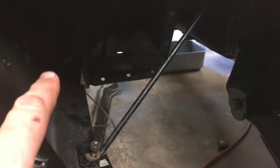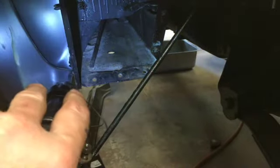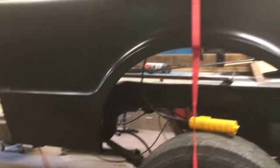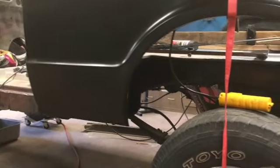I've had to drag it. The hole is in the outside of this rocker box panel, and I've had to drag the hole forward about a hole. It'll probably be about a hole and a half by the time I get done. So quite a bit, probably a half inch or so. I use my burr on the end of my die grinder and drag the hole. So I'll probably have to put a patch on that just so it doesn't look ugly, and it's a little bit more secure. But that's it. I'll make it to the other side tomorrow. Sure is nice to be putting some new parts back on the truck.